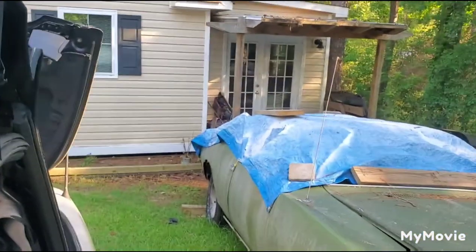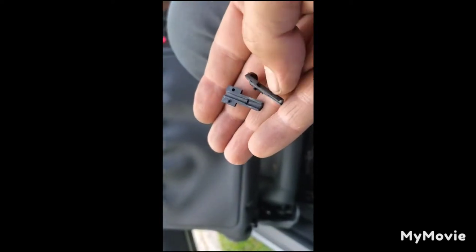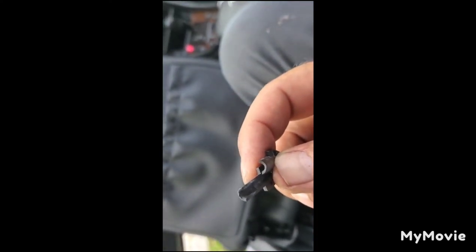Let me sneak this cable through and I'll show you how it's hooked up. Now that I got that cable through, I'm going to try to show it as much as I can. Over here, it comes out of this square hole — there's a hole right there. At the end of it, there's a little plastic thing which holds it in there. You put it over the cable, stamp the thing together, and then push it in. Be careful that you do not force it, and that the squares line up with the cutout in the rail.